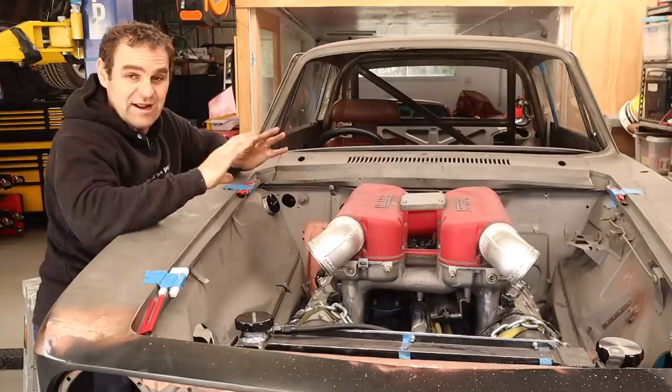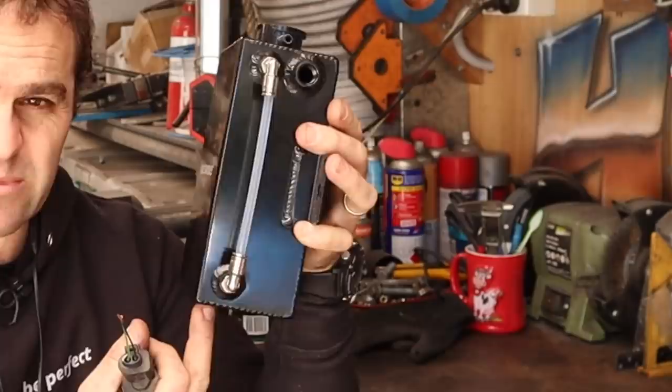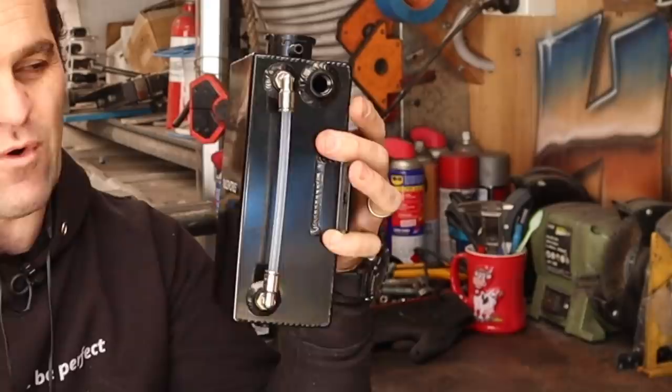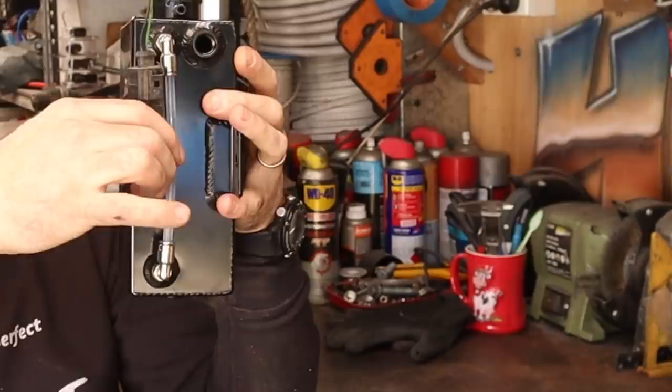This car didn't have anything with it when I got it — I believe a lot of them had a bag that sat in the side of the engine bay, but I don't have it and I don't want anything else visible in the engine bay. So I'm going to build a new washer bottle and make the fill point match the oil fill on the other side. I'm going to repurpose a radiator expansion tank and use a washer pump I pulled from my Audi wreck.